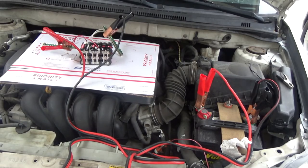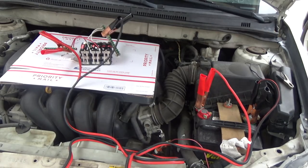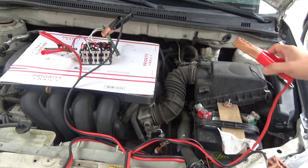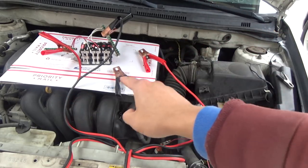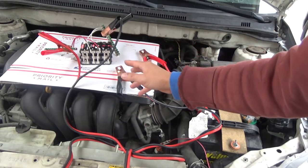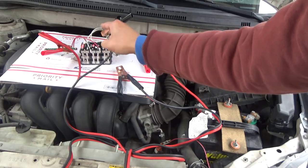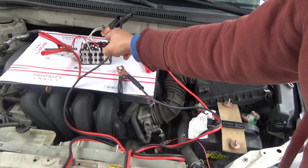All right, let's get ready. The reason why I have to disconnect immediately is because the alternator in the car will charge my battery pack at 14.5 volts, and that is over-voltage — this pack's maximum is only 12.6 volts. So once the car starts, you have to disconnect it right away, otherwise you will overcharge this battery pack, which is not good. Just a moment of overcharge is fine since it's not fully charged anyway.